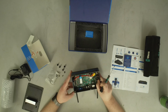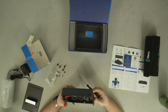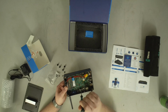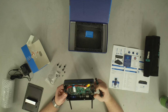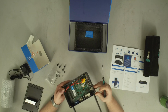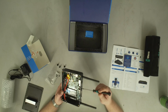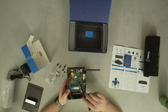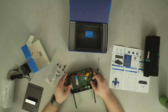And it looks like we've got a big metal plate on the top, and then I'm told this shell is a composite material to help dissipate heat. So the CPU is actually on the opposite side of the board here, probably directly here where there's 4 screws. We'll definitely do some thermal testing. Since this is a unit that I can modify, I may even drill a tiny hole in here and run one of my thermal probes inside the case, or maybe try and fish it through one of the gaps in the chassis to measure the temperatures from the inside as well when we do testing.